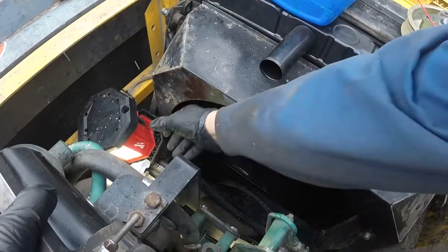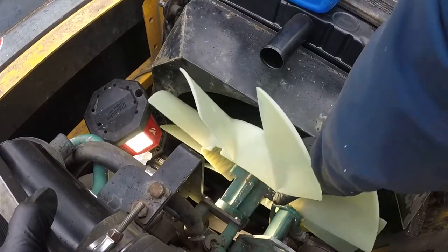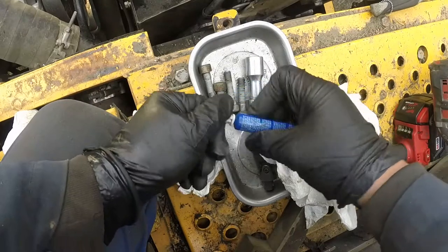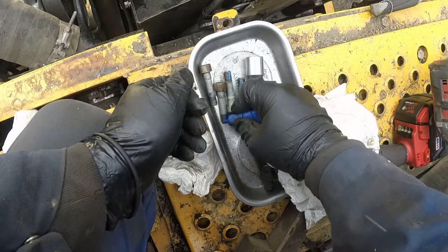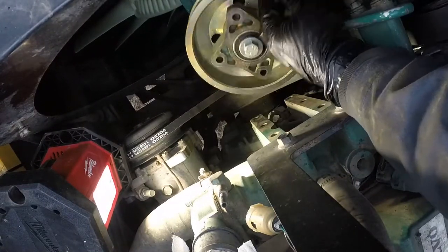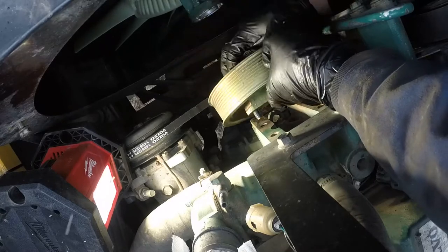See, it started snowing a little bit. Snowflakes are falling. Okay, we have our radiator cooling fan assembled with a tower. It's time to put it inside the shroud. Apply the blue Loctite thread sealant to those fan hub bolts, and place the bolts in. On the hub there is a hole on the housing. You will see the hole. It should face down. Yeah, you will find that.